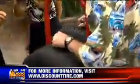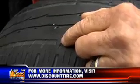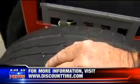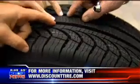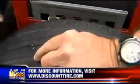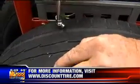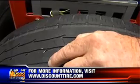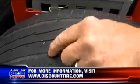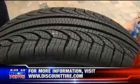Here's another thing. See those little teeny bars right there? Those are called wear bars. If you don't have a penny and you see these, you can't see them over here because they're way down in there. But if they're exposed, that's another easy way to tell. In fact, the highway patrol can look at your tire going down the freeway and see these bars, kind of like an oscillating timing light. If you ever get pulled over and they say you've got bad tires, that's why. This is another really good indicator. You never want to get this low.